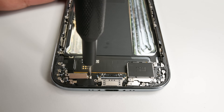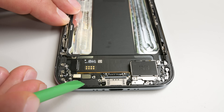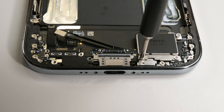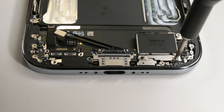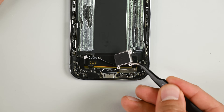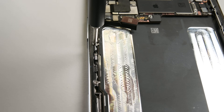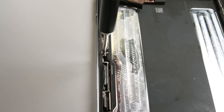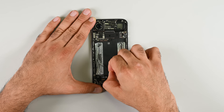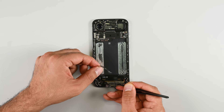Moving on to the lower assembly, I'm eyeing that USB-C port — there's a little mystery here. In the last couple of iPhone designs, this part's gotten more modular, but the Apple Store won't fix your iPhone 15 or 16's USB-C port and you can't even buy one from Apple. It's a super common failure point. Before I can get to that port, I need to deal with brackets, cables, the Taptic Engine, and some tricky-to-access screws. The USB-C port's flex cable runs the length of the phone up to the logic board, and the port itself has flexible glue doubling as a gasket that needs to be sliced away. It's not the easiest port replacement, but at least it's still modular.